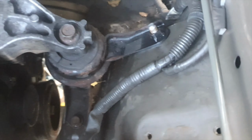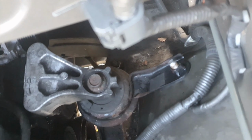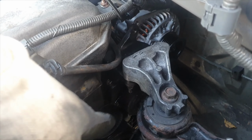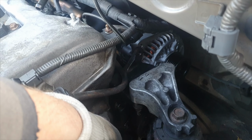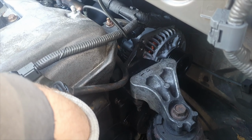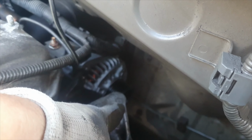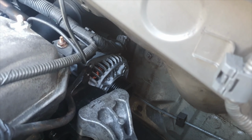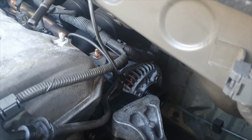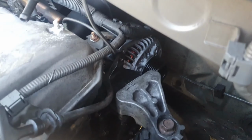The one in the wing and the two mounting bolts into the chassis, that one there, and then there's one on the other side which you can't quite see, they're all 14mm. The bolts that the engine side of the mount fix onto the block are all 14. There's three of those in there, two at the top and that long one down the bottom behind the tensioner wheel. On the back of the alternator, the bottom long pivot bolt is a 14mm, and the top one up here is a 12 basically, which locates the top of that. So all fairly straightforward. Don't bother trying to undo this, it's just a complete pain, and I didn't bother.